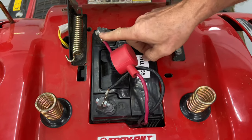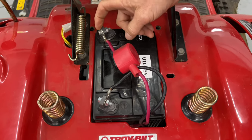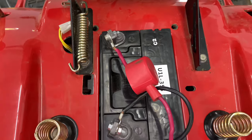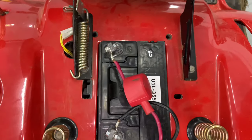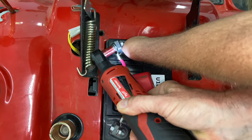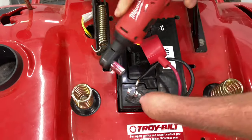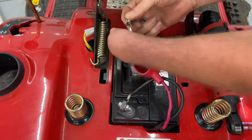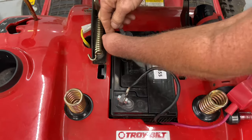You're going to have to take these terminals off. It's either 10-millimeter or 3/8ths — normally they're 7/16ths and 3/8ths. Be very careful when you take these apart. I'm very close to the metal over here, and when you take these off you don't want to touch metal, because you will arc, and that's not good — it'll scare the heck out of you. Get the positive off. You can take off the negative first, but if you hit the positive to any metal around you, it's going to arc, so be very careful.